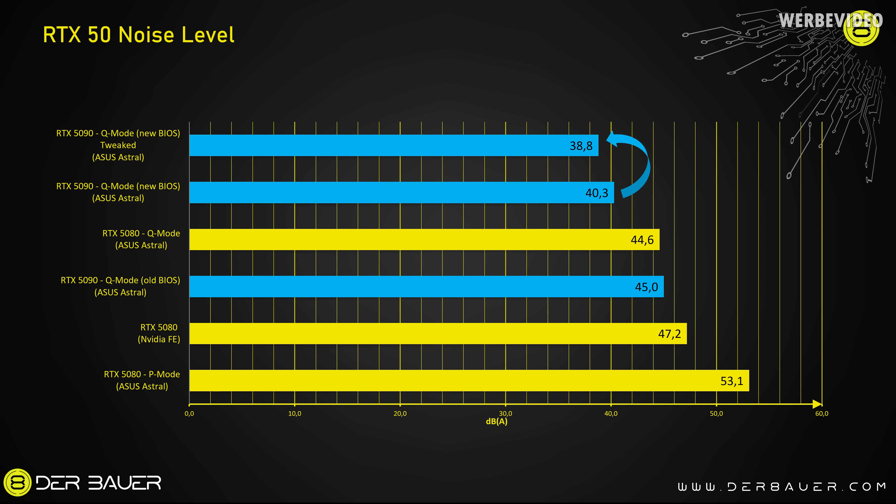The problem here is that it's not just about decibels — this is a huge improvement, don't get me wrong, and it's now in a state that I would personally use it. Prior to that, no way — it was just way too loud, especially in P mode, and in Q mode it was still too loud. But it's not just about decibels; it's about how the fan sounds. I can tell you it's an annoying fan the way it's built. And if I can within five minutes find a way to improve it by increasing the left and right fans and lowering the center and rear fan, I would expect the same from ASUS — they made this, they should know it better than I do and be even quicker at optimizing this.